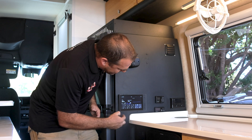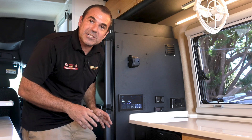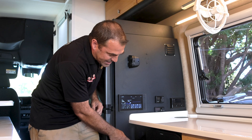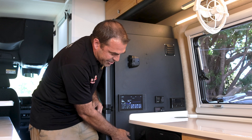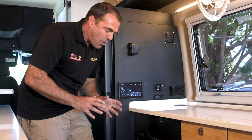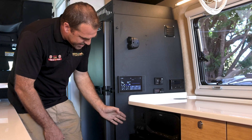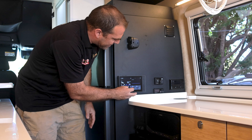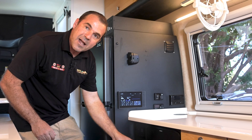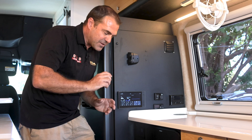DC was on, so my DC turns everything on. I had a bit of water on my water pumps running. What I wanted to show you — we've been doing a mod outside. When I turn my water pumps on, that will suck from the front tank. I now have a solenoid — I can turn on the front tank, or switch to suck from my rear tank at 85 litres. I can turn on my rear tank. If I want to work from a caravan park or draw water from a creek or billabong, that's the third switch — that's for my Visiflow. So I can select tank 1 at 85 litres, tank 2 at 85 litres, or outside water from my Visiflow. The water pump switch has to be on — if I'm not getting any water at the taps, it's because I don't have one of those switches on to draw water. That's something new that Kimberley's introduced instead of having shutoff valves in this unit.